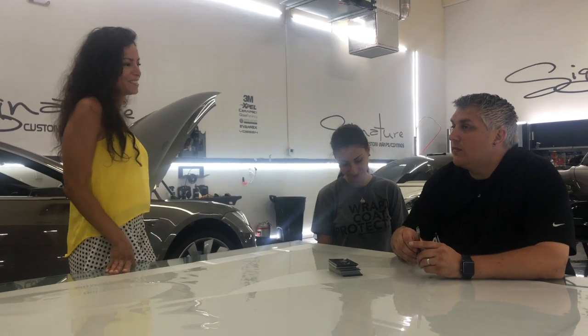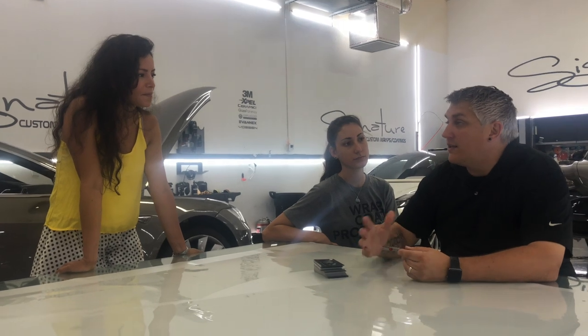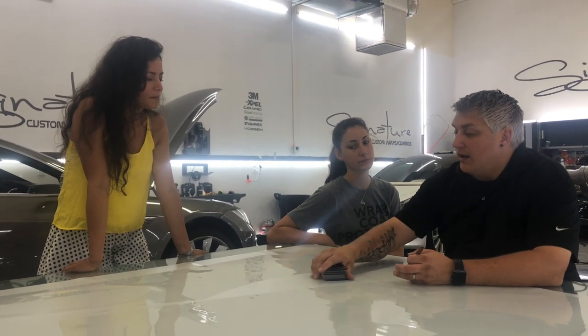I've seen a lot of videos on YouTube that talk about buying your wrapping vinyl on Amazon. What's your opinion on that? I don't know how to do taxes — someone went to school and learned how to do taxes. So to me it's kind of the same thing. It comes down to the right tools, the right conditions, prepping, knowing how to prep things. Buying anything off Amazon — not a good suggestion. There are a handful of manufacturers and distribution people. Valoris, Metro Restyling — the vinyl sits in a climate-controlled warehouse, things are regulated. You don't want it to dry out; the adhesive will be bad. Everything has a shelf life on it.